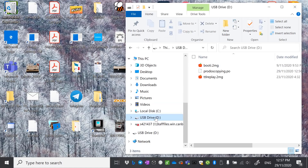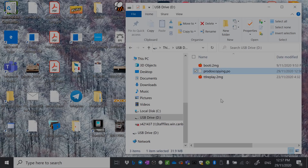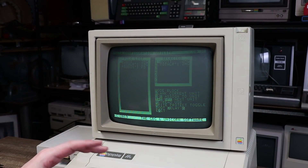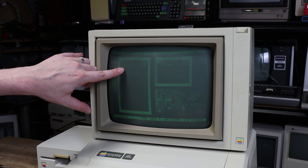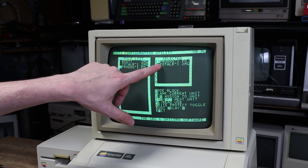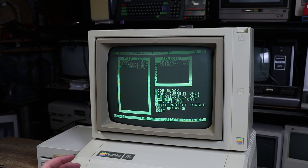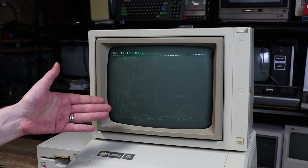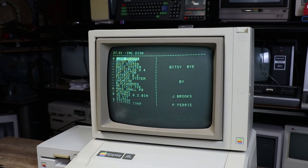And if we have a look on the USB drive, we've got the Booty image file, Total Replay, and our new one. So all we need to do now is take this thumb drive and plug it back into the Apple II. With the machine booted back up, we're back to the config screen of the Booty Card. This is the file we just created in CiderPress. We go down, hit one, and it puts it into slot one. We can now simply go exit and one, and it boots into ProDOS and all the files we just wrote to it.